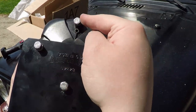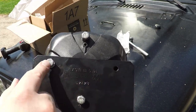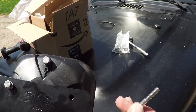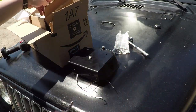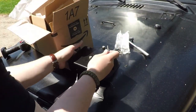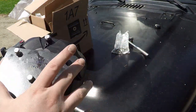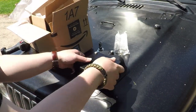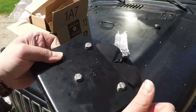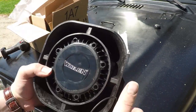To get it mounted to the plate, you're going to leave the top bolt in and take the bottom bolt out — at least that's the way I'm doing it. Then you grab another one of these bolts from the bag. Before I put it in, I want to get some lubricant on it — just some rust preventative. Now we're just going to get this one in here and tighten it down. Just make sure it's torqued down enough so the bolts don't come loose.